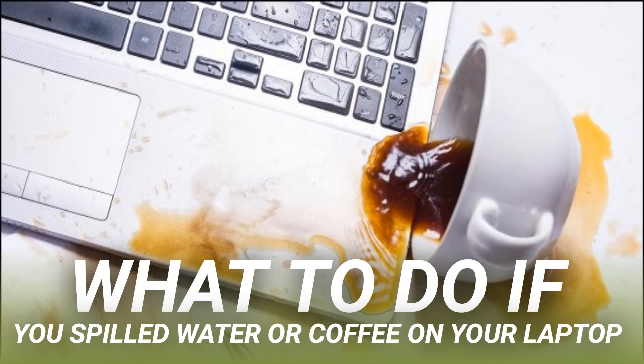If you're comfortable doing so, remove some components to help things dry out. It should be fairly easy to disconnect and remove the SSD or hard drive, as well as any sticks of RAM you spot. Take a photo before you start if you want a reference for reassembly. Dry any obvious moisture in the laptop and on the components with a clean, lint-free cloth or towel — paper towels work fine. Make sure you dab rather than wipe to avoid leaving anything behind. Place your laptop and any components you removed in a dry, airy spot for a minimum of 48 hours. Don't use a hairdryer, heater, or any other source of heat to dry your laptop, as this could cause further damage.